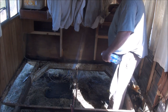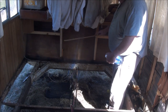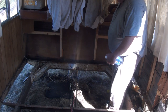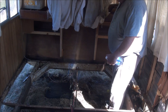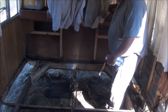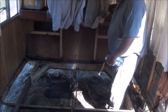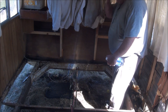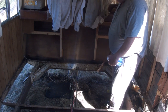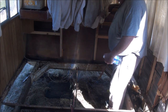I think I'll lay a 2x4 down here, and then maybe just do 2x4 supports the whole way all the way back. I don't know if I want to go 16 or 12 inch centers. OEM is 12 inch. 2x4s are not very strong for floor joists, especially laying on the flat like that. So maybe a 2x4 on 12 inch centers. It's going to be lots, but I'd rather put a few more than a few not enough. So not much to say here other than what an awful job.